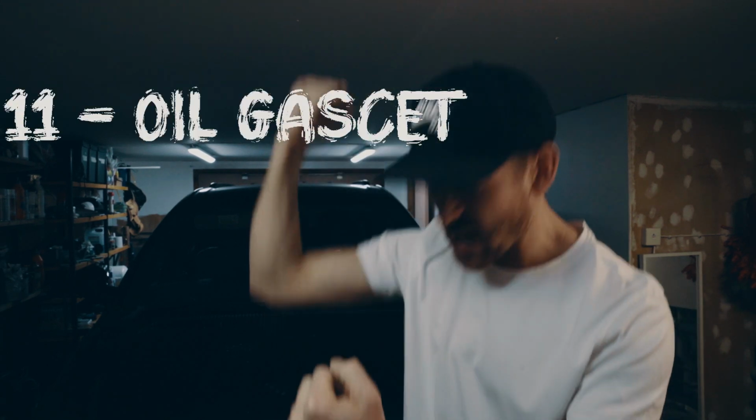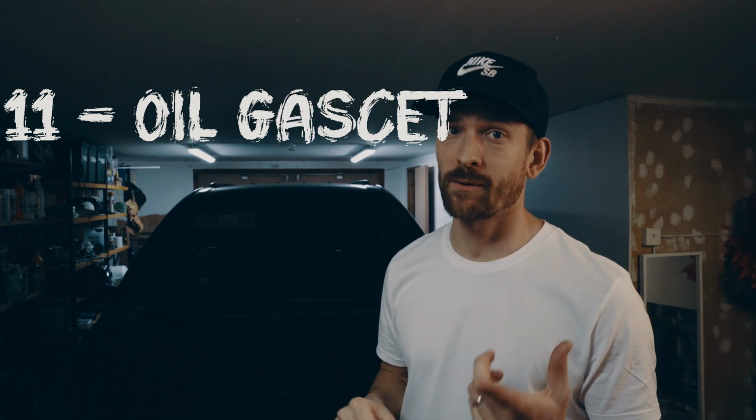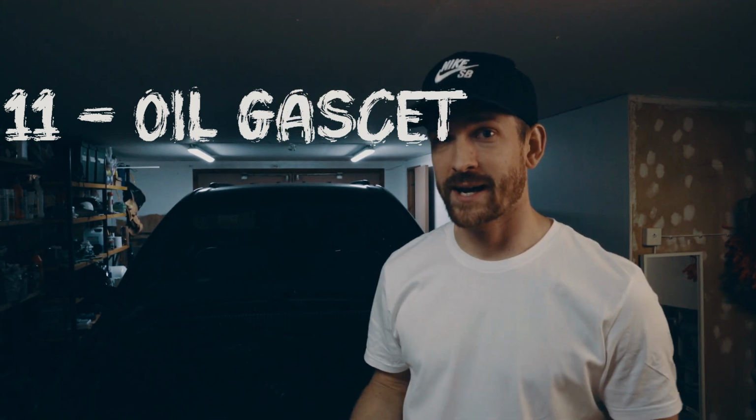Number 11! And also a common problem with this car is that the oil tank underneath and the transmission oil tank, or what it's called, quite often leaks oil. So we need to change that gasket, and that we will do when we do the service. So we can empty all the oil, get rid of the tank, new gasket, and up again so we can stop the leaking because it's quite wet underneath. Okay, but I think that's it.